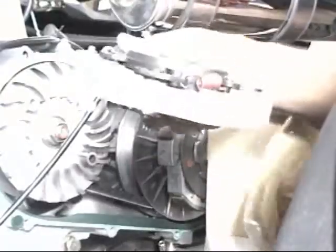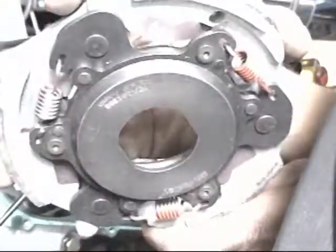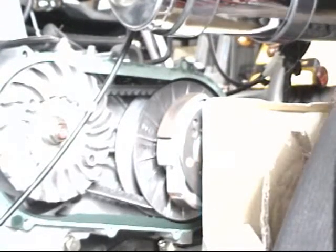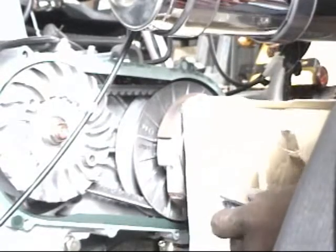So it's different from other clutches that we sell. As you can see, it activates differently. And it comes with everything you need plus the little clutch springs. When you open the package, you're going to see the traditional clutch springs on the outside, and on the inside you're going to see the push springs, which we call the pillow springs, which are different from the other clutches on the market. And it's also going to have an extra set of springs. You're going to have the red ones, the yellow ones, the blue ones all in there. So these grab the clutch weight and it activates differently.